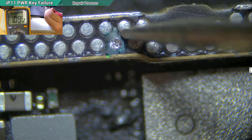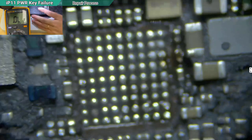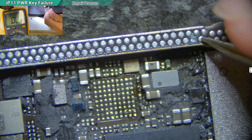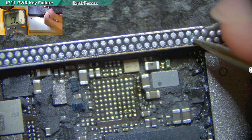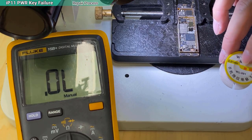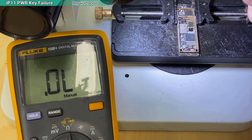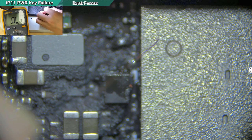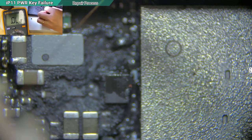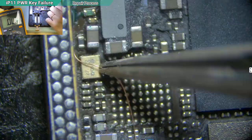Ground checks are normal. Once I jump it and put back the IC, the value will appear. I check between the power button and the dot — power button reads 50 and the other reads 0. Now I'm going to use a 0.01mm wire. There are many sizes — 0.02mm is one option — but 0.01mm is thin enough that you can still install the IC on top after routing the wire.